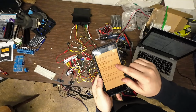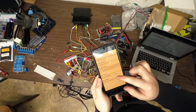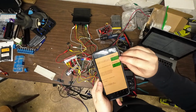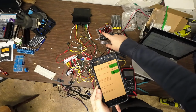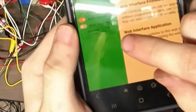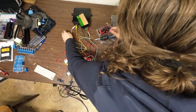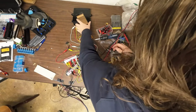stm32_loader.bin file to update the bootloader on your OpenInverter board. You can download the file, the links in the forum here. I just did that. So what I'm gonna do is firmware, install firmware from file. I'm gonna set this down on top of it, has its best likelihood of installing version 2.20.a. We're currently on version 2.17.a. Set it on top, load from file, files, bin. Okay, installing firmware.